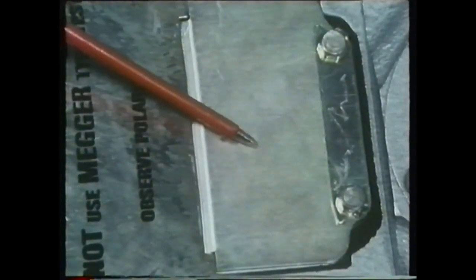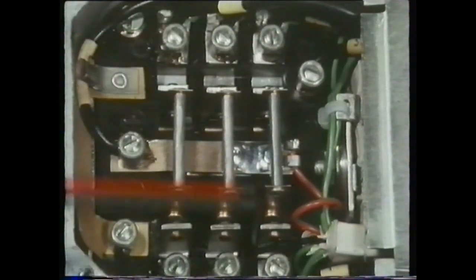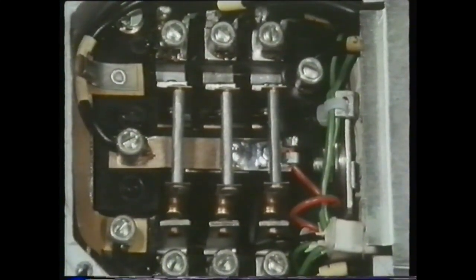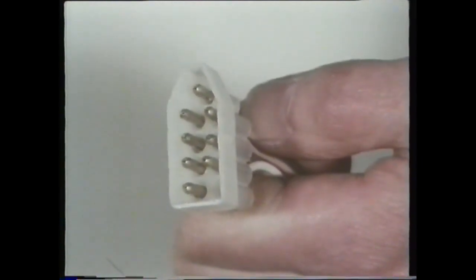On the other side of this change speed unit, the two-speed protection device is situated here, and beneath this cover are the electrical connections of the unit. If on any occasion a flow of current isn't available to the EP unit plug, check that all of the wires and the connections here are secure and that there are no signs of corrosion. Also, operate the change speed unit and ensure that the contacts are, indeed, making contact. Then, on occasions when the vehicle you're servicing is fitted with an intermediate connection between the change speed unit and the EP unit, ensure that there's electrical continuity through the connection.